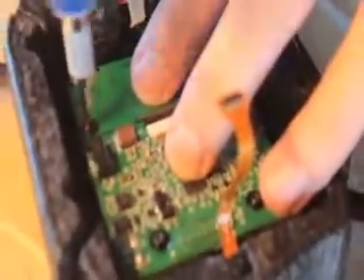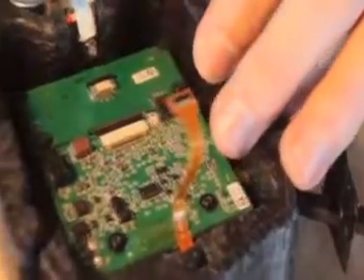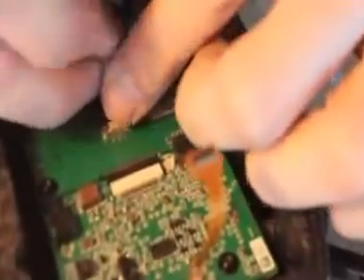Two sharp-end screws — you'll want to put those in there, probably with some glue or double-sided tape. Sharp-end screws here as well. Switch bits. Two large screws. Take your white cord and push it into that little black and white plug. Get it in as far as you can and then snap that black plug back into place — it'll snap.